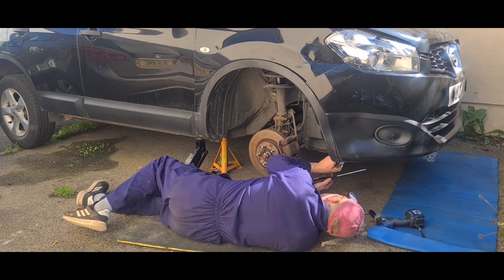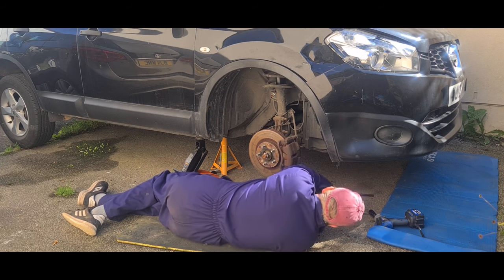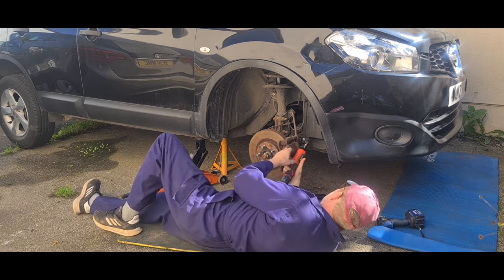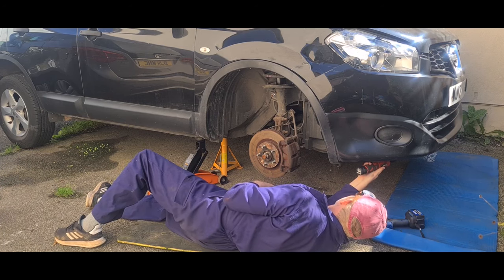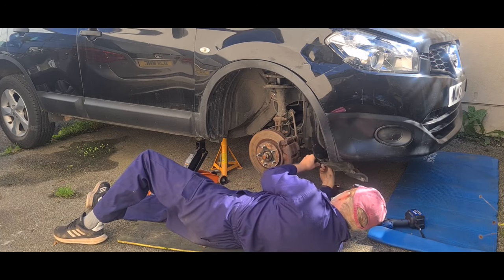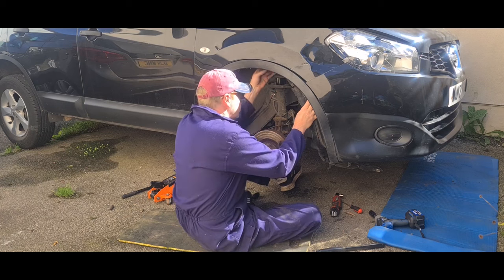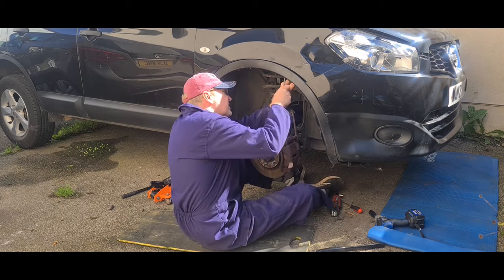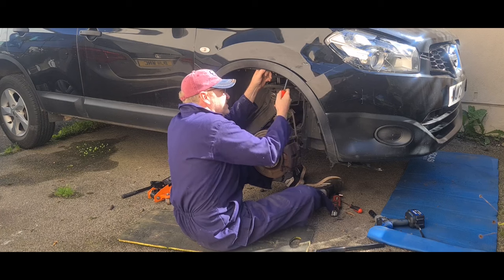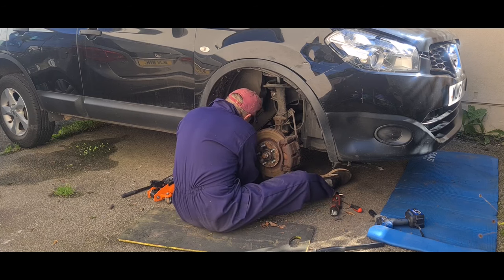These look like pop rivets so I'm assuming they don't actually come off. What we might find is that by taking off this lower scuttle panel, this will fall away — that's entirely possible. I did find another screw here. If you haven't got yourself one of these power ratchets I highly suggest you do — pretty cheap, makes the job so much simpler. Now we can see what we're doing with that arch liner. The first part of the arch liner is at least loose. This wing's battered anyway, so it's not like we've got to be gentle. We just need to make sure we don't break anything. Oh, here's a nice bit of headlight and some leaves in there.